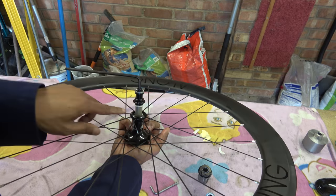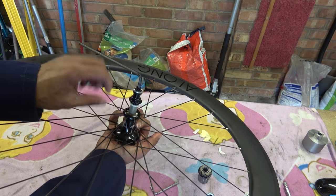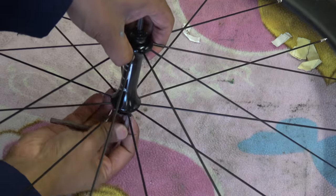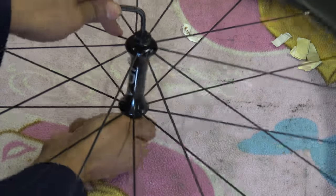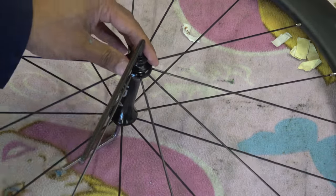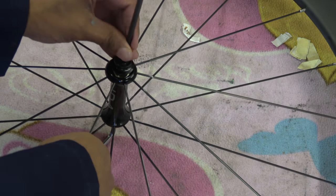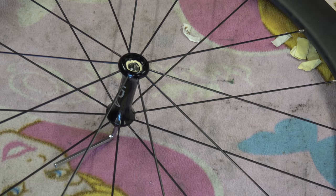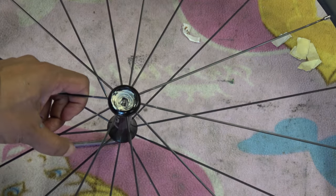And that's the other side — so you've got an axle, a threaded axle, and in that side is also a 6803. This is the front hub. To get this apart, again a couple of allen keys or hex keys, then we just turn that anti-clockwise. Just move my hand so you can see it. Fairly run-of-the-mill. It's an extremely small bearing on that side.